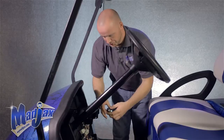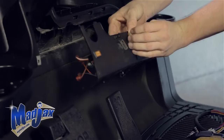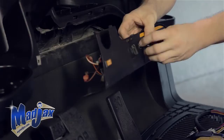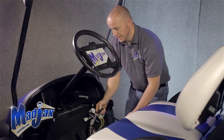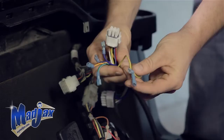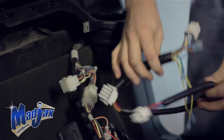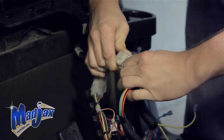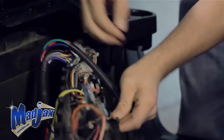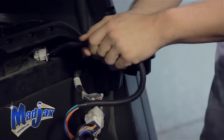Once we have our dash removed, we're going to take our knob off of our push-pull switch as well as the first nut. Insert that through the hole we drilled in the first step, reattach our nut, and put our knob back on. Once we have our push-pull switch installed, we can attach our main harness. The main harness consists of a nine pin connector, four other wires that go to our ultimate light kit upgrade, two yellow wires which run to our push-pull switch, our 12 pin connector which mounts to our factory harness, and a six pin connector which we run to our front headlight. We'll attach our 12 pin connector and attach our push-pull switch. Once we have our other wires safely behind the dash, we can run our six pin connector through our channel for our front headlight.